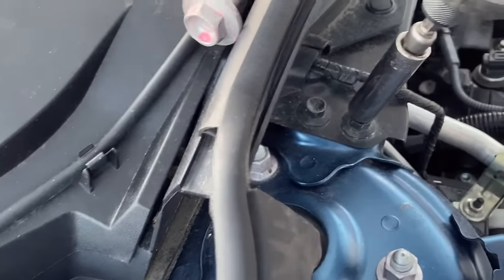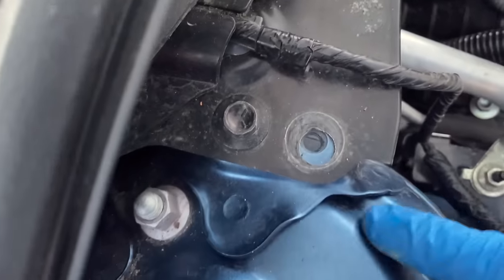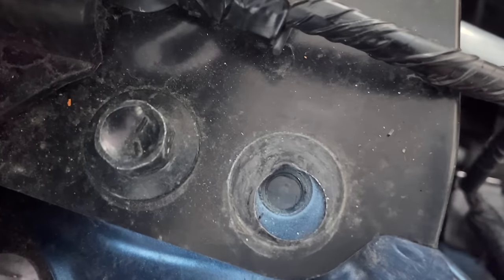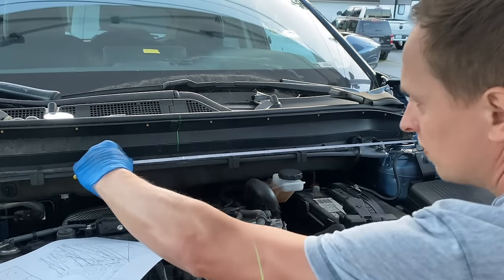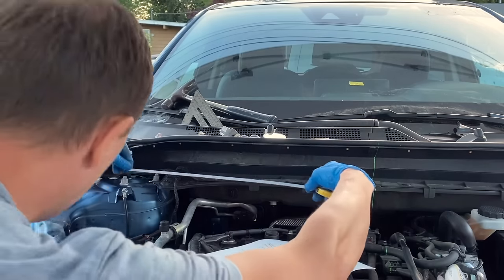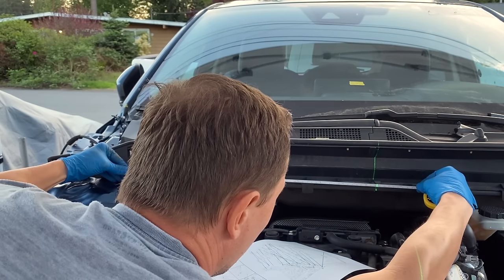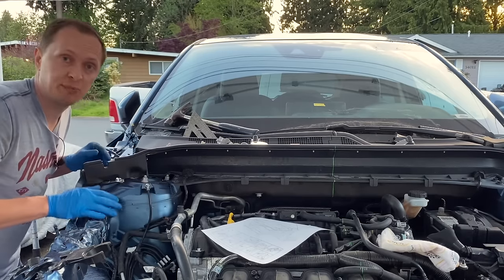While probing around further, I removed the bolt connecting the driver's side strut tower to the strut tower brace — the bolt hole is sitting exactly in the center of the brace hole. But on the damaged side, the strut tower is sitting quite a ways in, and the brace even got dimpled and bent right on that corner because the strut tower got slammed into it. Measuring from the center of the strut tower bolt to the beam: the undamaged side is at 589 millimeters, but the damaged side is at 583 millimeters — the strut tower got pushed over by about 5 to 6 millimeters.